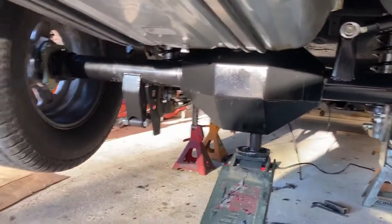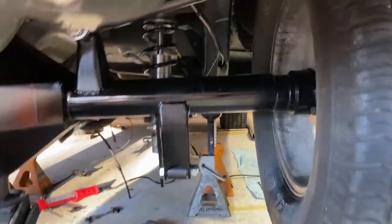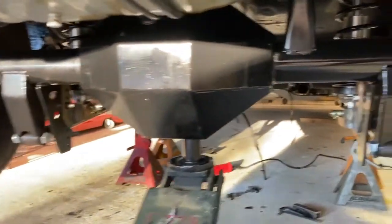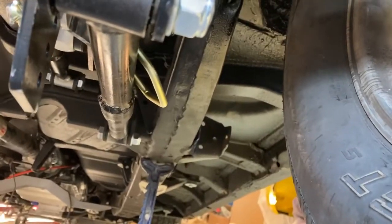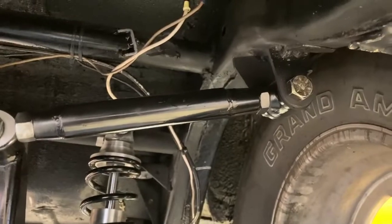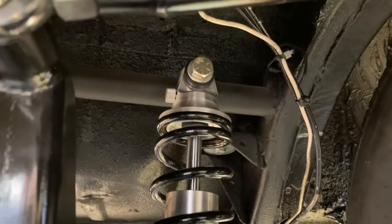And there's the new rear end — fabricated nine-inch Ford, all sitting up in here. The shocks are all mounted up in the front, so when you're looking down under the car, all you see is that rear end — it's not cluttered up with all that other stuff. The four-bar setup is all in here. There's one bar here and one bar on the bottom. It goes over this side. You can see the frame rail. Coilover shocks, pan-hard bar is mounted to the frame, and the shocks are mounted on that tube up on top.